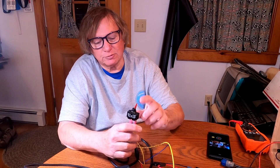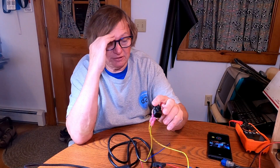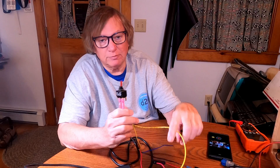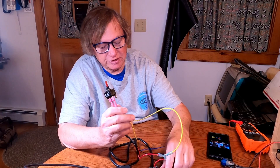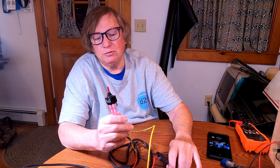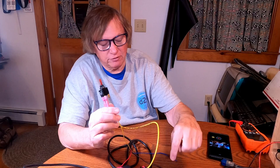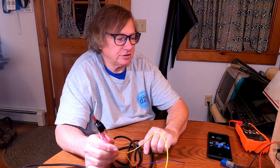That'll enable me to give you more videos like this and more in-depth stuff. Again, this was one of the videos that some of my subscribers and viewers had requested, so this is it — simple switch. I used this for probably 10 years on my first boat before I switched over to using solid-state relays and separate batteries and stuff like that. But this works — this arrangement works for a single battery source. It doesn't matter whether this power supply is going to your starting battery, your electronics battery, or whatever — it all works the same. Just make sure the ground and the power wire go to the same battery. Thanks for watching. Bye.